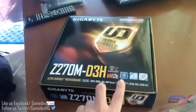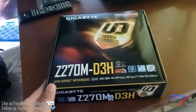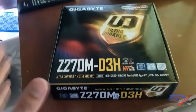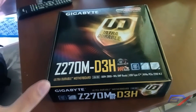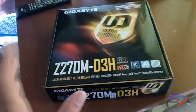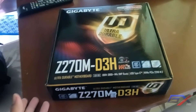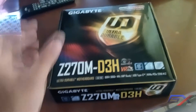This is a new 270 series chipset from Intel. The motherboard uses socket LGA1151, which is compatible with 6th gen and 7th gen processors. There is also the Z170 series designed for 6th gen, and the Z270 is designed for 7th gen, but this motherboard supports both, so if you have a 6th gen processor you won't have any problem installing it.